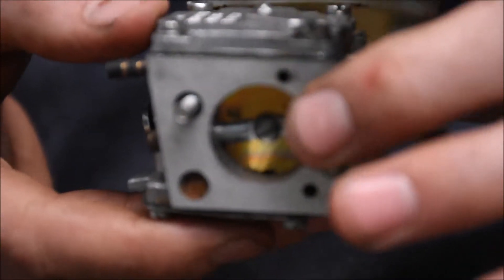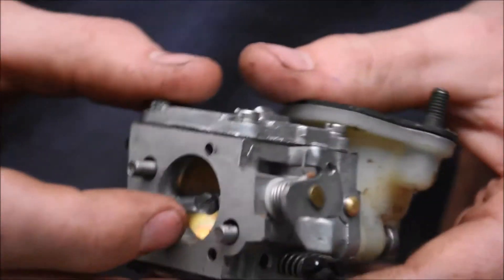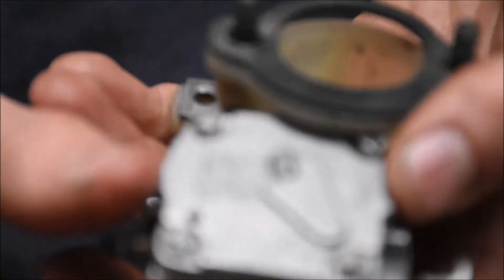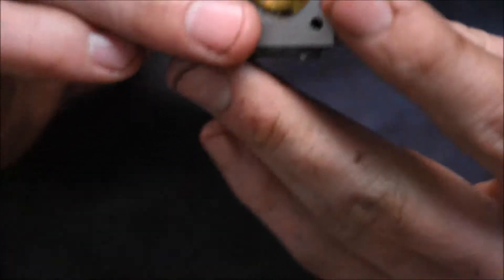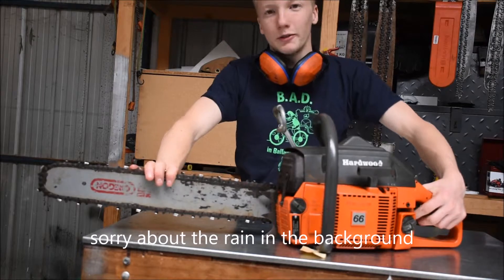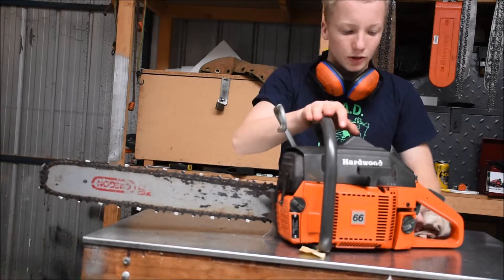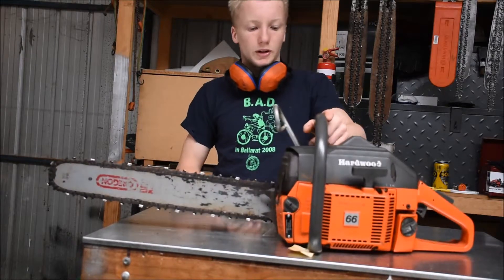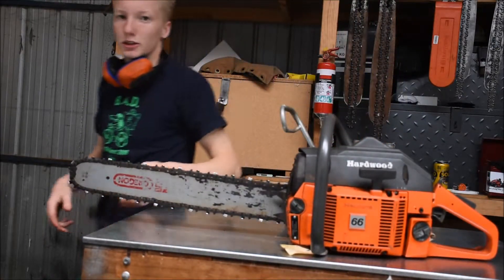A little bit of a trick with this carburettor when you're installing it: the hi-lo and idle adjustments go to the ignition side. When you're putting this together have the square side up, not the round side, and they should match up and it should work. I got this all together after lots of faffing around with the carburettor — it was really starting to annoy me so I just switched the camera off. Got that in and installed everything else around it, which was pretty easy. Put the bar and chain on and now I'm going to give it a test start.